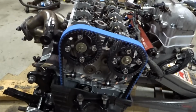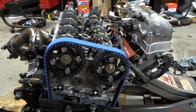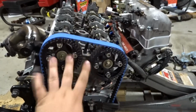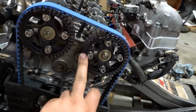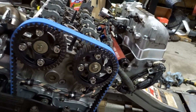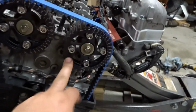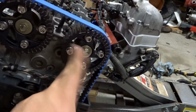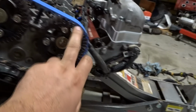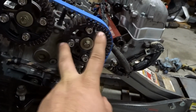So, yeah, about time to get this thing going. But anyway, camshafts are installed. If this is a B18A, Steve, who was Moto XXX Man on Prelude Power, went through degreeing these, and he said if it's a B18A that it would technically be retarded 5 degrees, so you'd have to actually advance it 2.5.